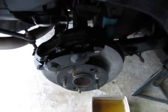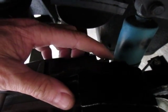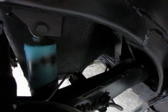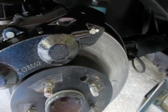Here's the right rear, all installed — same situation. On the back bleeders you actually have two bleeders: one out here by the wheel and one over inside by the axle. The fluid comes in back here on the back. I also installed new trailing arm brake tubes. My other ones were kind of rusted. Several years back I already put new brake hoses on it because they were kind of clamped up and causing my brakes to drag, so basically I've got a whole new system here. They also installed a plug here — a stainless steel plug.